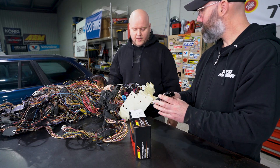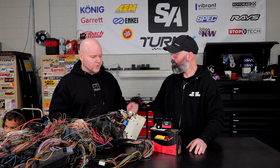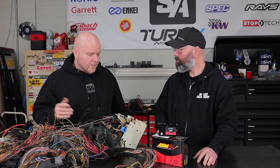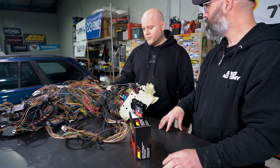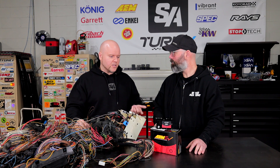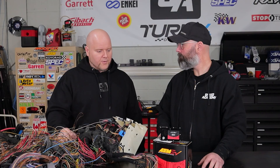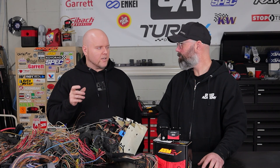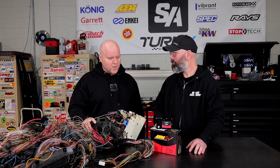In some cases relays have even more. And this is just a dumb function where you hit a switch and the thing turns on, but you can also program logic. Once you blow a fuse, until you pull over and figure out which fuse is blown and replace it, that function is out for the count. Whereas with this, you can program it to retry automatically because the fuse is virtual. If it ever fails, the thing detects an overcurrent, shuts off the output, and then pulses it asking 'can I turn this on? Is the problem fixed?' And then it will be able to operate again.